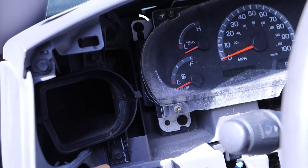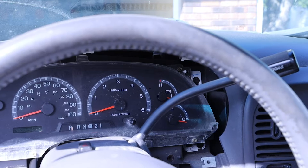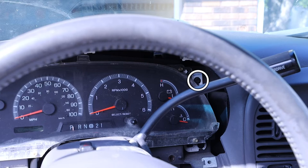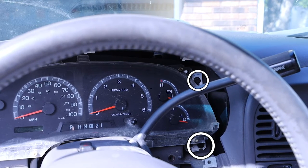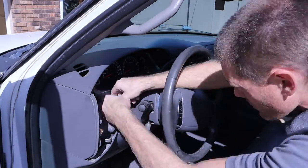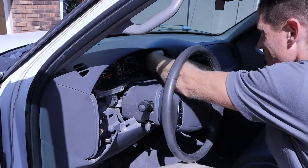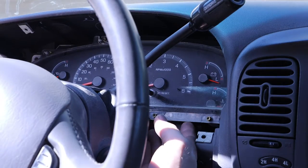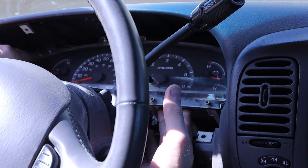Taking a look at the upper left and bottom left corners of our instrument cluster, we have two additional bolts that need to be removed. In the same way, we have one on the top right as well as the bottom right corners of that instrument cluster — all four of these bolts need to be removed before we proceed. This is done using that same 9/32nd driver. At this point our instrument panel should be loose and we can slide that out just a little bit.